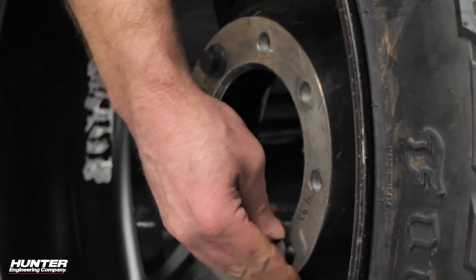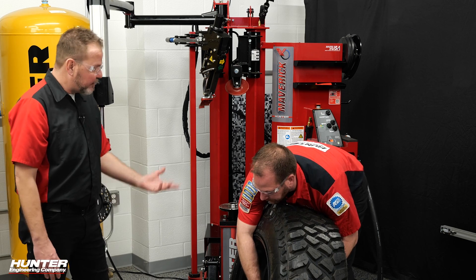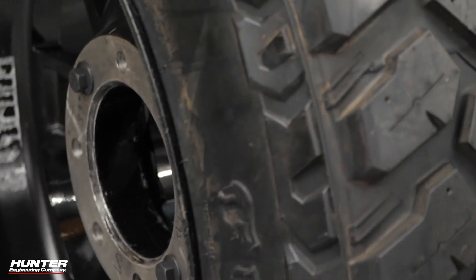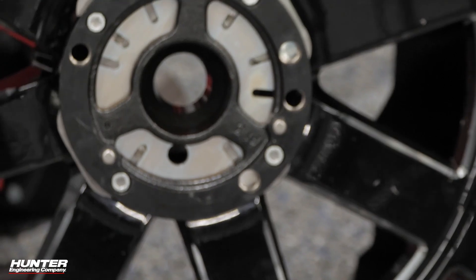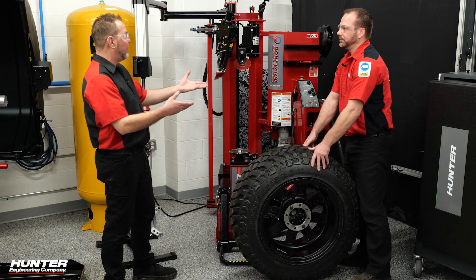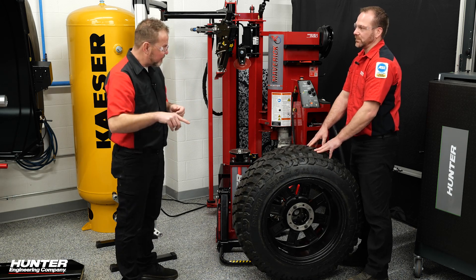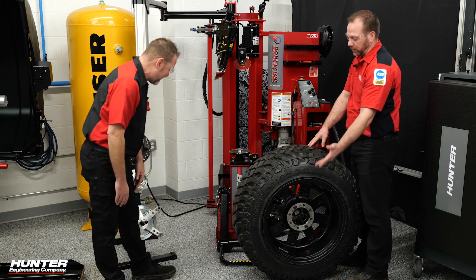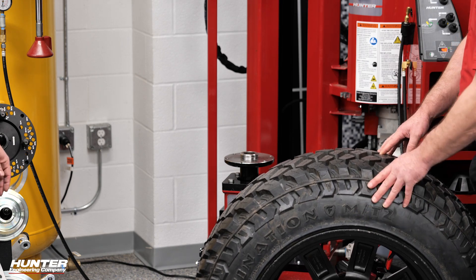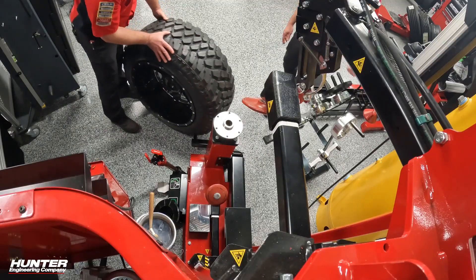The flange plate keeps a good amount of distance from the front of the rim to protect it from scratches or damage — no one's going to see where the lug nuts are. It attaches to the wheel just like that. Now, this is where maybe some people don't realize: we're mounting it upside down. That's reverse drop center — make sure you turn it around. We're actually going to take the inside and make it our top bead, taking that one out first. Seems a little odd, but once you do a few of these they come pretty standard.